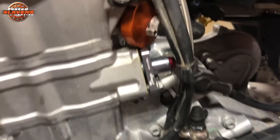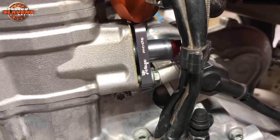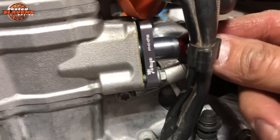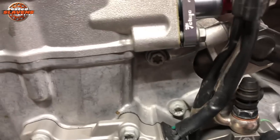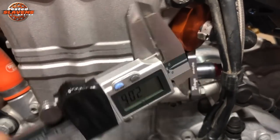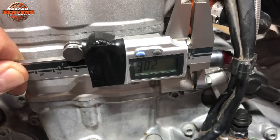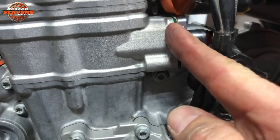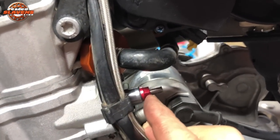The instructions from here are pretty easy. They tell you to screw the bolts part way in, and you want a two millimeter gap right here. Get out whatever you have for a measuring device — I used a pair of calipers and measured right there. I set it up at two millimeters so that the gap is consistent all the way around.